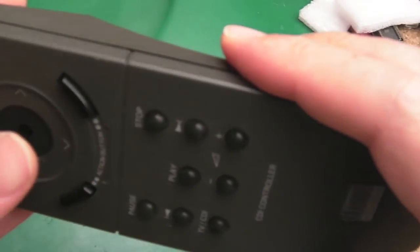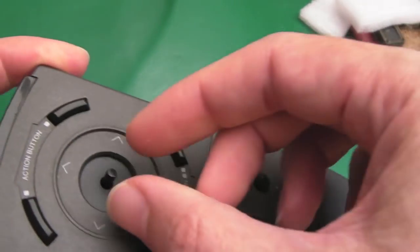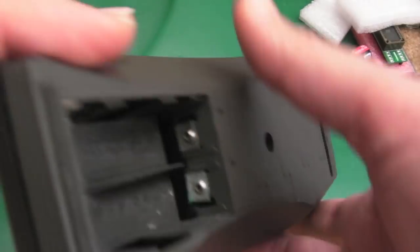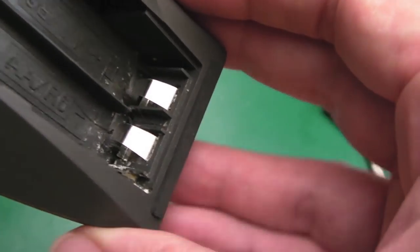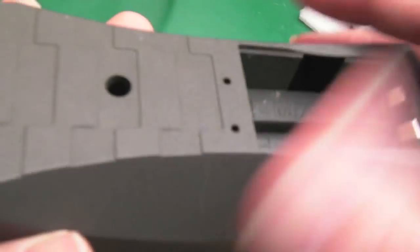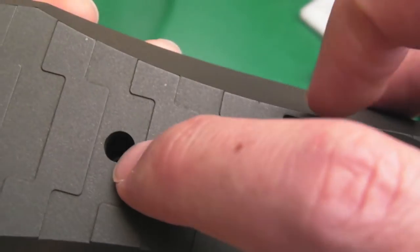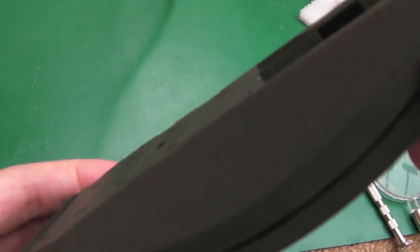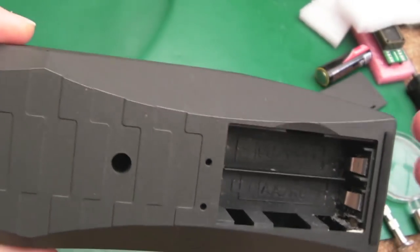I'll take a look at this controller next, see if we can do something with the cap for the top of that, because it is a bit painful to use that way. We'll deal with the corrosion in here as well — you can just about see the blue contacts there. We want to make sure we've cleaned any of that up, because ultimately it could cause a failure at some point. It looks like it's a single screw in the middle — it's a torx, I think. And then it's going to be clipped around the edges, so I'll have to use something like an iPhone removal tool or a credit card.